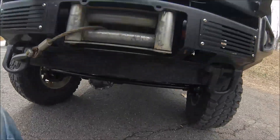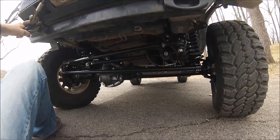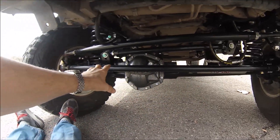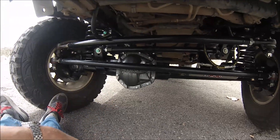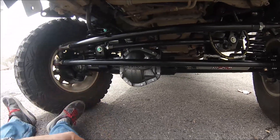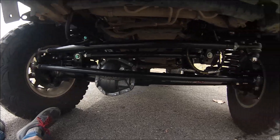Underneath, this truck has some interesting parts. Usually we use a GM low pinion Dana 44 or a corporate 10 bolt. Sometimes we will use a custom high pinion Ford housing where we've relocated the pumpkin over to this side. But on this particular build, this is actually made by Solid Axle Industries. This is a virgin casting — a nodular iron high pinion Dana 44 pumpkin that you can buy, put your tubes in, cut it to the right length, and weld your C's on. And that's what we're running here.